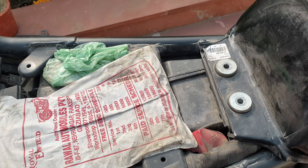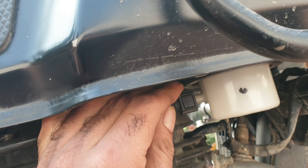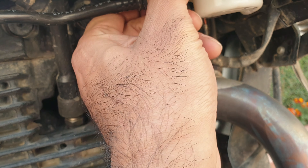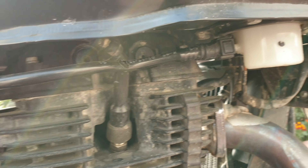The nuts are out. Next, let's move to this clamp — some fuel is going to come out. You see this small tab here? There is one on the other side as well. Press it with both two fingers like this and then pull it out. I'm going to require the other hand.